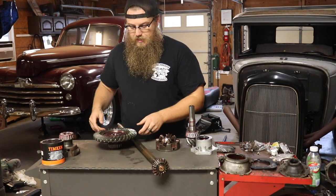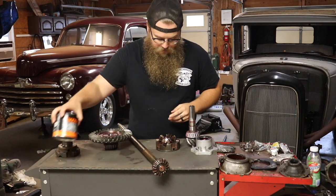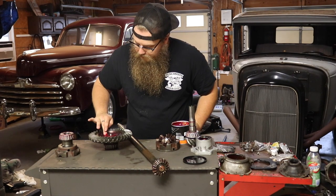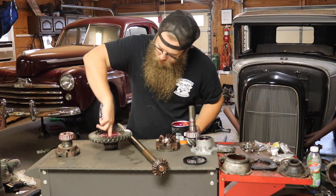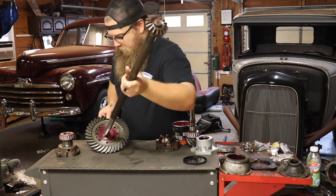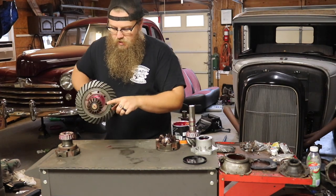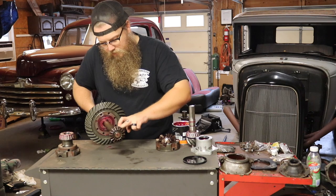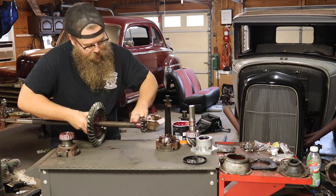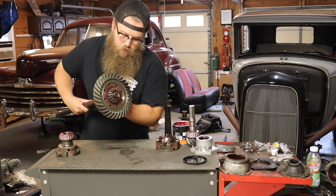The first thing I'm going to do is slide the axle through the ring — I haven't had the ring assembled yet, so that's part of this process. I'm going to go ahead and add extra lube down inside the ring where the axle is about to sit. I'm going to slide this down in, re-hit it one more time, because this area is really important — it's where everything rides together. These are all mating surfaces, so nice and greased up.